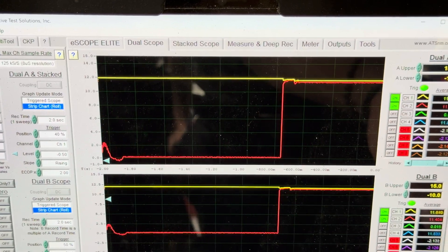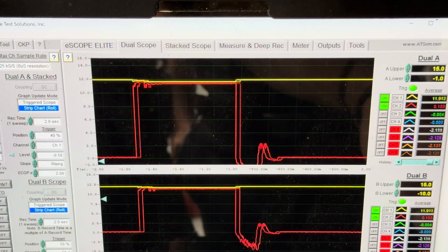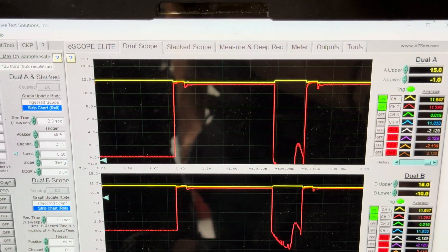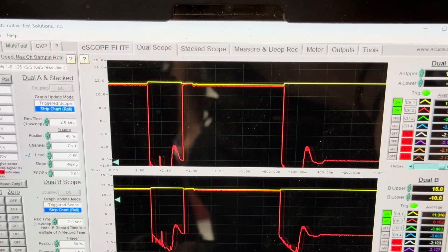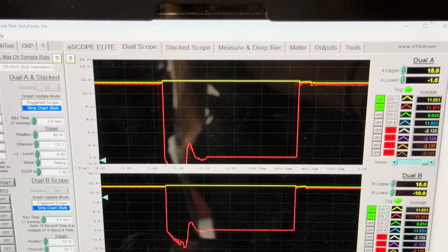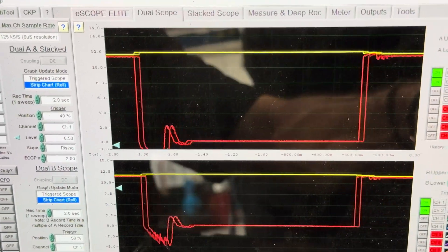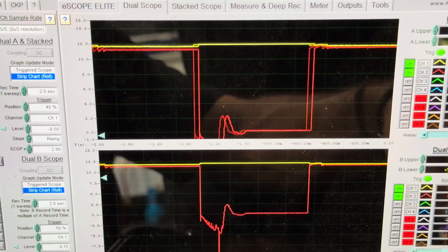Sometimes that means getting good notes and finding out exactly when it does it and under what conditions. We've got to figure this thing out. I'm just keep hitting it. A lot of this could be that when the relay gets hot — people say, how many times are people opening it? But you've got to imagine during the middle of the day, the inside of this car is 140 degrees easy. That relay can get hot and maybe she goes to put her stuff in the trunk and she can't open it.